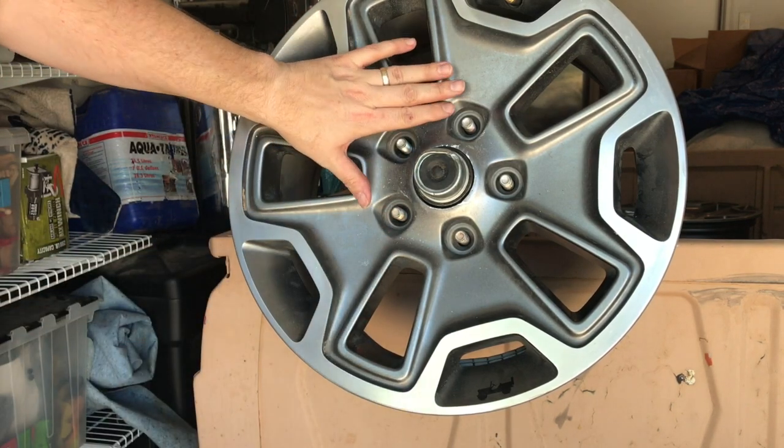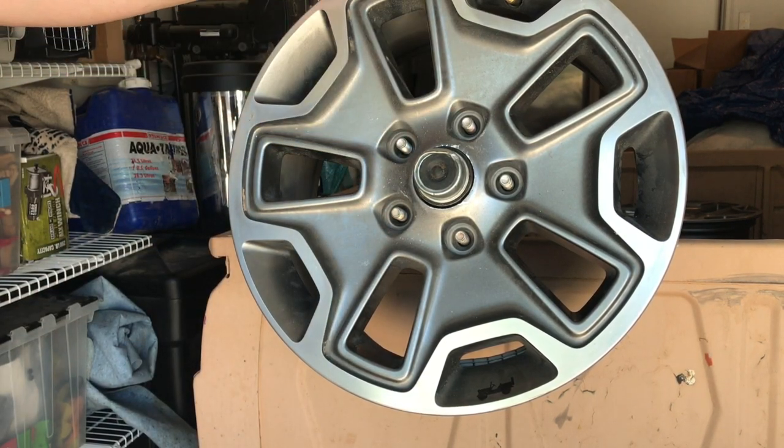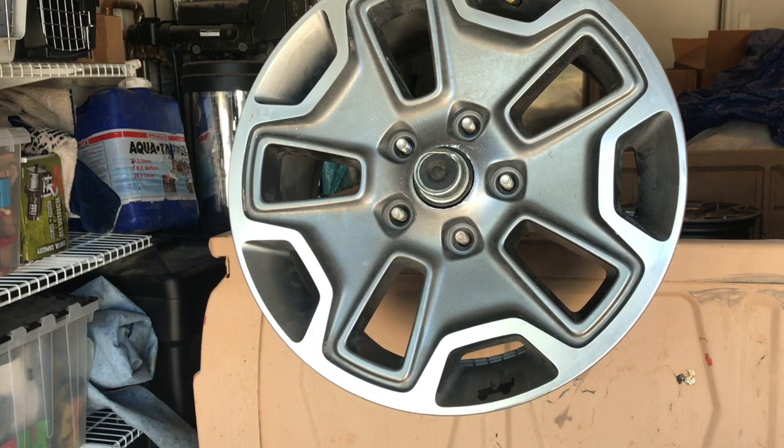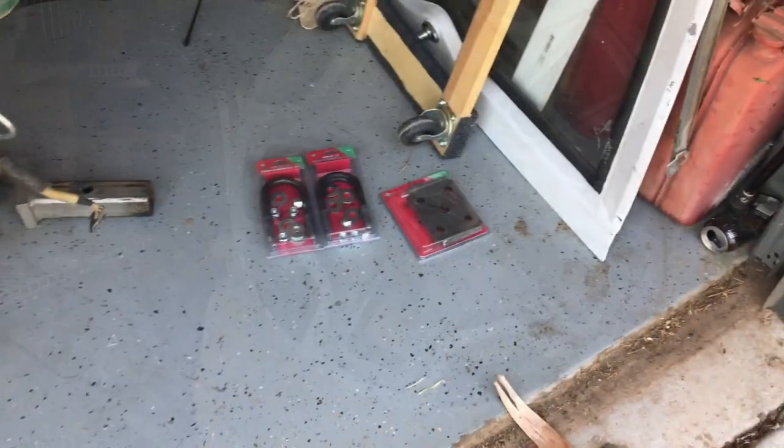So like I said, we have an off-the-shelf axle that we can run a factory wheel on with the factory backspacing. Nice, good width on the axle, 3,500 pound capacity, and it's not going to stick out super wide on my old 1975 truck bed trailer. So, all right, on to the next one. All right, got my U-bolts and plates. That's going to work well.